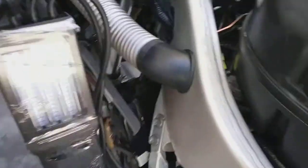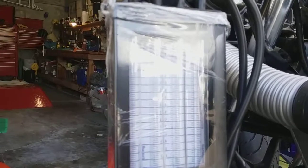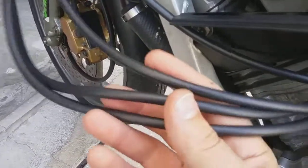As you can see, the bike just needs to be ridden. New battery, new carb kit, and got her dialed in with this carb tune. What I like about the carb tune is — I'll shut her down — you don't have to synchronize the carb tune. It basically is maintenance-free. I still got the plastic wrapper on it. Super simple to set up — you just take your hoses and cut four inches off one end, stick the little clear tube in there and splice them back together. Do that four times and then you just hook it up.